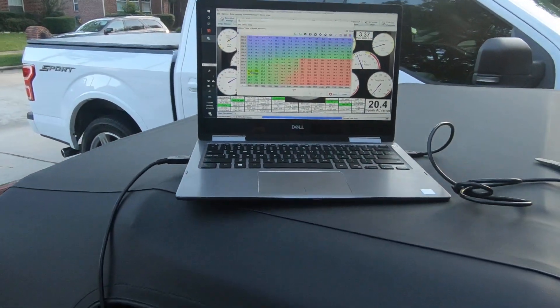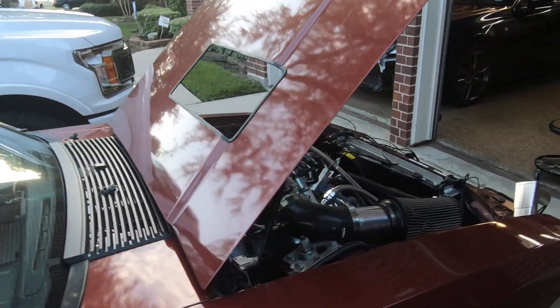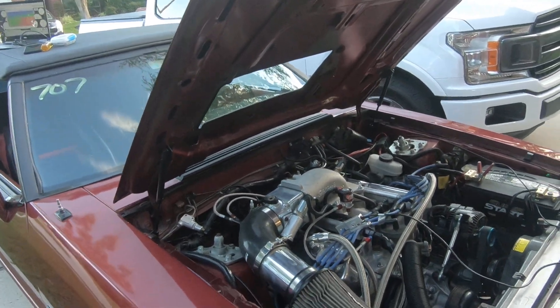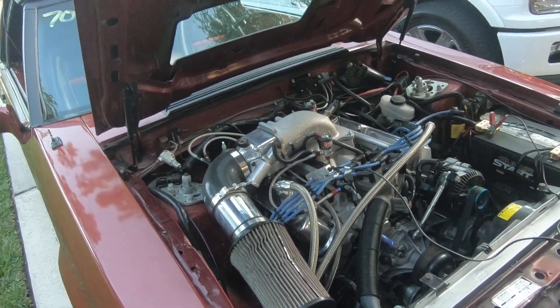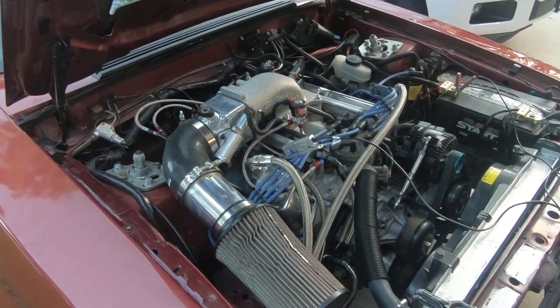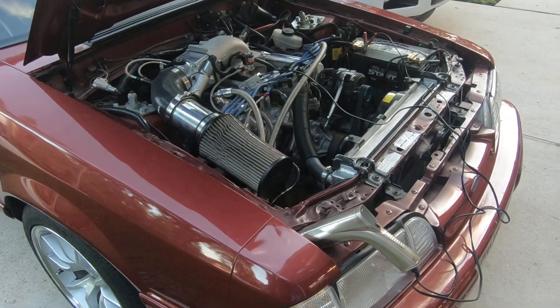That's about it. The main point to take away is that you do not need to remove the PIP adapter. You simply use the software in TunerStudio to toggle it from 'use table' to 'fixed timing,' get it synchronized, and after that TunerStudio takes care of the rest based on the ignition table. Hopefully that helps — shoot me a message if you have any questions. Thanks a lot.